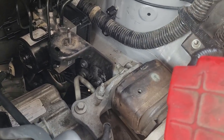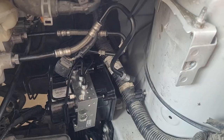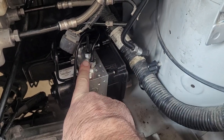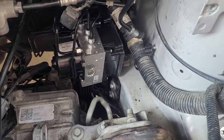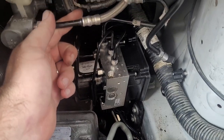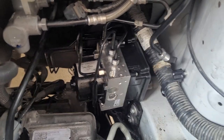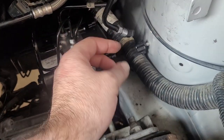It's a tough spot because of the transmission cooler line right there, but if you get this bracket off it makes life a lot easier. I've got the first brake line off — it's a 15mm nut — and I've got that brake line zip-tied out of the way for easier access to the others. The next two are 13mm, and the very back one is also a 15mm. Just take them off in order. I capped off the lines with rubber caps to keep from draining brake fluid out of the reservoir, which will make it a bit faster to bleed when we get it back together.